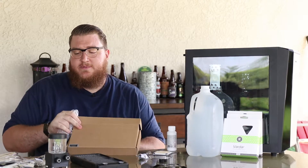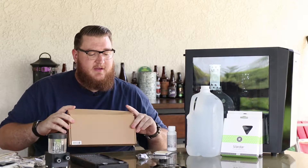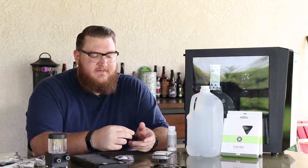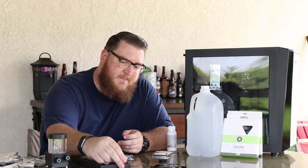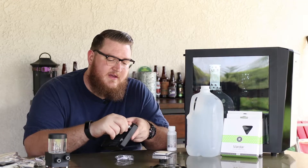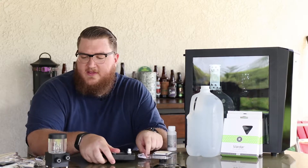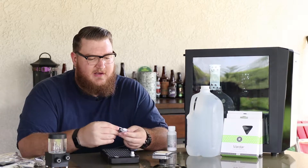You're probably wondering how do you even start with all this and put it in there? It's pretty easy actually. What we're going to want to do is put some fittings on the radiator — the easy stuff first. Now you want to be gentle with this and don't cross thread it, because it is aluminum — it's a fairly soft metal. You don't need to get them super tight, just tight enough so that the o-ring seats. Otherwise you might strip it, since again it is all aluminum.